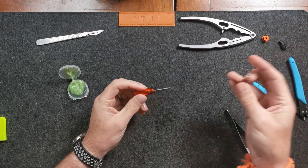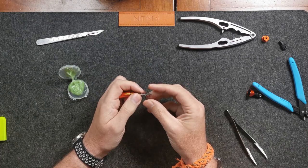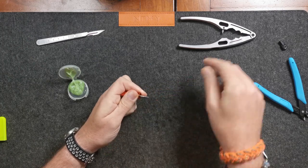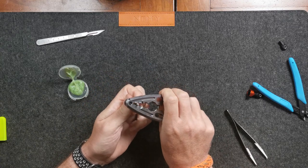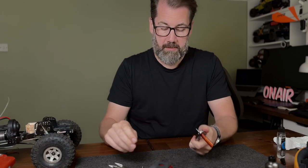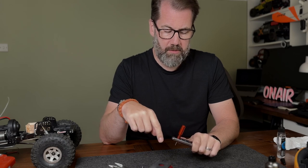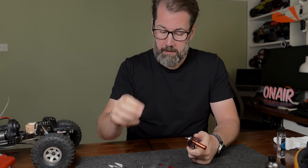So then we're going to install the spring and the spring cup. And this is obviously where having some shock pliers is handy. They're not very expensive. They're definitely worth having if you're going to get into this sort of building and rebuilding shocks. Definitely get some of these. I'll put you a link in the description to these ones, which I think I either got off Amazon or Make It Build It, but we'll find a link for those.